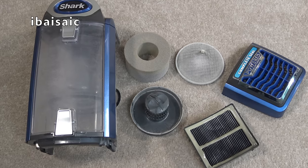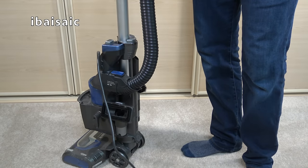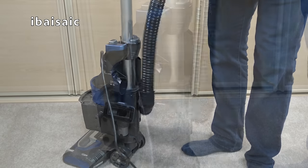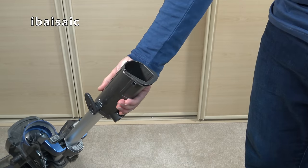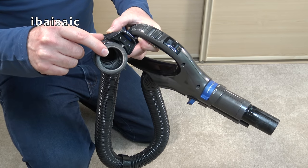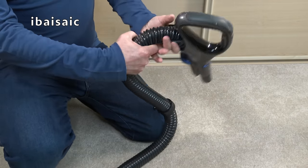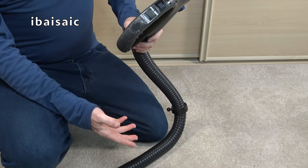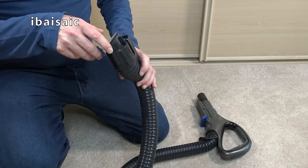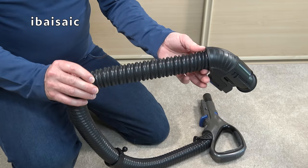Now that I've removed all these parts, I'm going to give them a clean before fitting them back on the vacuum cleaner. Next, I'll show you how to check for any blockages, starting with the flexible hose. To remove the hose, press the hose release button and also the handle release button at the top. Once removed, it's easier to check for blockages — start by looking down the hose; you might see debris just at the entrance or where the handle is. If the blockage is further down, try stretching the hose gently and shaking it. Don't poke anything sharp in the hose as it will damage it, and it contains electrical conductors — you don't want to damage the wires housed within.